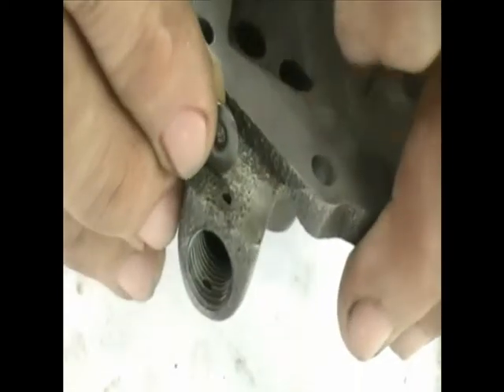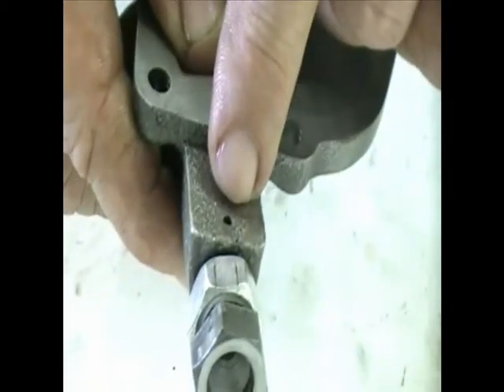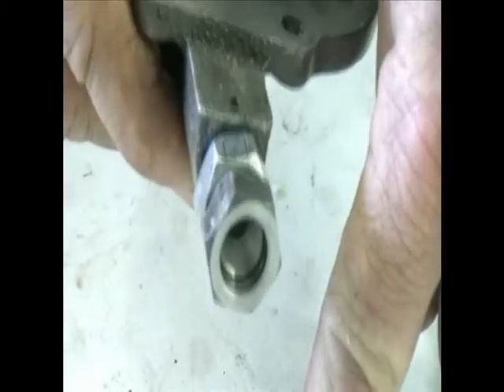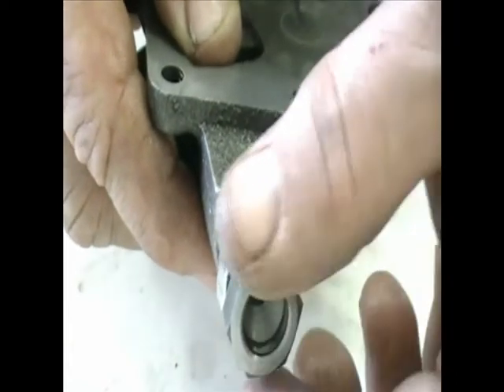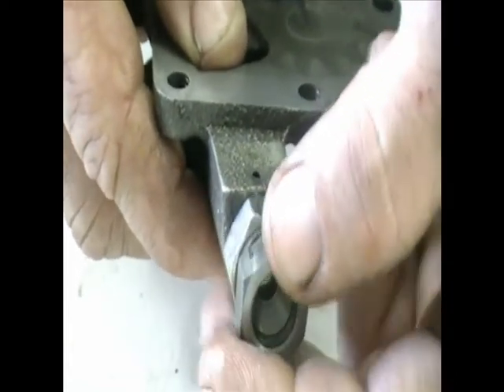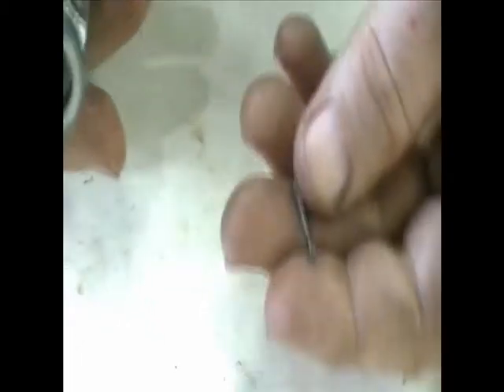When that was at the right position it gave me the pressure I had before. When I screw that in, I can look right down through the hole straight to the other side and see where the pressure was before, then give it another half turn if I want and lock it off. It's an adjustable pressure regulator — a lot safer than having that little thing fall out and the pressure regulator spring fall out on you.